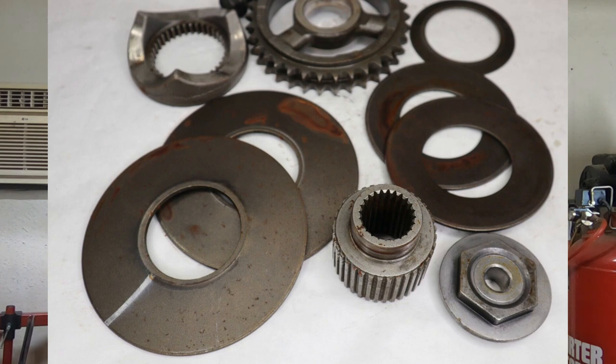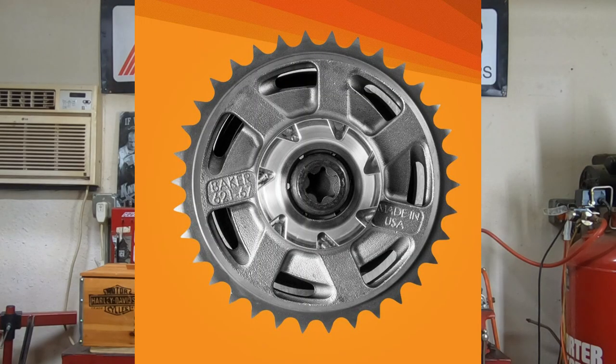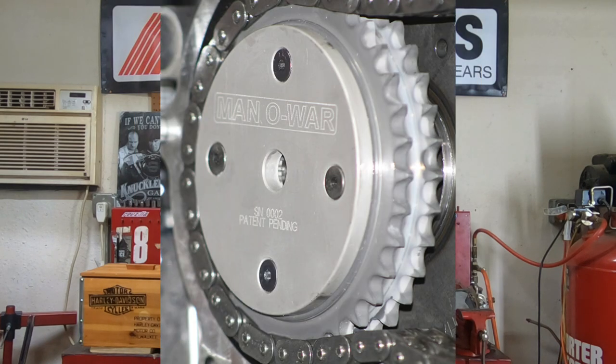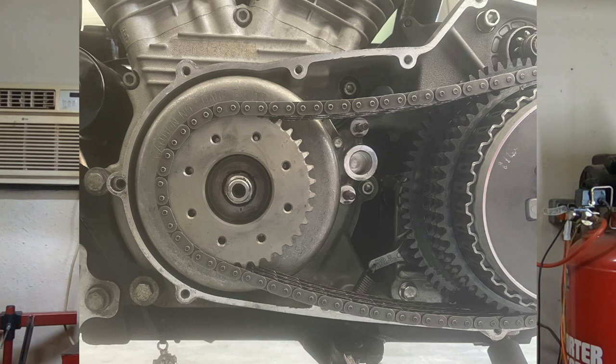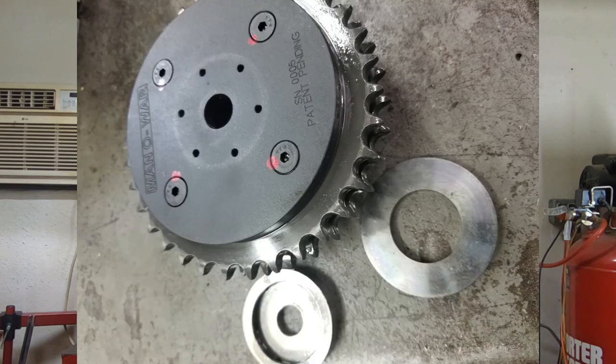One other weak area with the twin cam engine has always been the compensator. If you like running a compensator, there's nothing wrong with it, but they cost a lot of money — a Baker is usually about five or six hundred bucks, and honestly those things break too. What I'm a big fan of is the Dark Horse compensator eliminator. The Sportster uses basically just a drive sprocket, so you upgrade your twin cam up to a drive sprocket. What I like about the Dark Horse is they took it a little further — it's actually got a cush drive in there that helps absorb some of the shock from starting and shifting. At the same time, it's also rebuildable, so later on down the road if the cush drive wears out, no problem — you can pull it down, change it out, and it's completely rebuilt and ready to go.